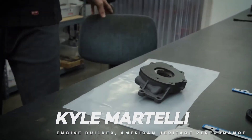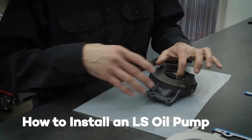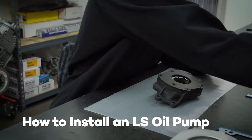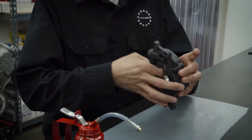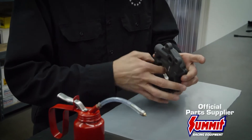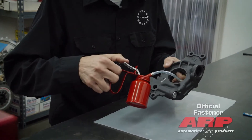So what we want to do here first — these come from Melling and from wherever you're getting your oil pump from, a little bit pre-lubed, but I like to take it a little bit further. Because if you can hear that, that sounds very metal on metal-y. Still sounds dry. So I always like to take a little squirts of oil and get it in here.